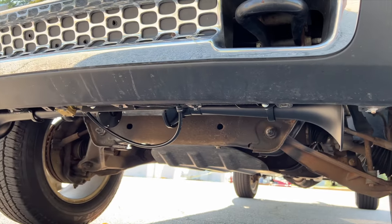And then when I thought I was done, I had it tapped to my factory horn, and for some reason it wouldn't work. There's a little valve inside the solenoid that I accidentally put in upside down, which I want to point out and highlight to you guys, because I feel like that's a really simple mistake that a lot of people can make, and it's not something you would know you put in upside down just because you've never seen it. I also had an air leak somewhere and was losing air, so I had to go back and recheck and fix up stuff like that.